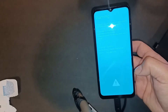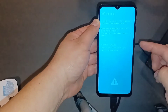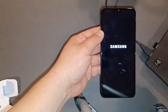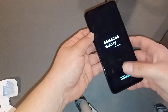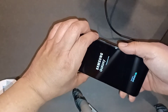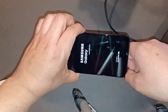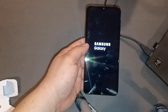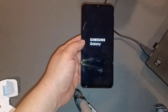That's the easiest way to do it. To get out of download mode, it tells you volume up to continue or volume down to cancel and reset the phone. I'm pressing volume down to reset since I don't actually want to stay in download mode — I just wanted to show you how it works. So in summary: all you need is a computer, USB cable, and press volume up, volume down, and power all at once, then plug in the cable, and you'll see that blue screen indicating download mode.